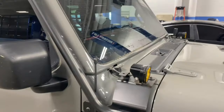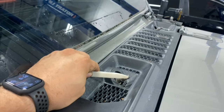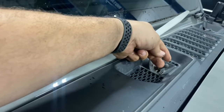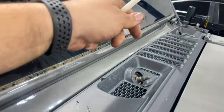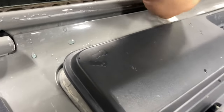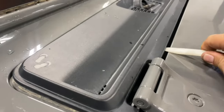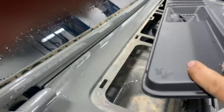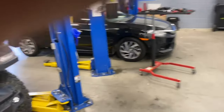It's only on one side, it appears. So I have 15 millimeter bolts on each one of these wiper arms — just take that 15 millimeter nut off. Then what I do is I rock it back and forth. You don't need a puller; you can just take them and rock them back and forth and they'll kind of pop loose and just pull them off. Then I got a plastic trim tool — what you're going to do is kind of work your way around it. It's just held in by clips, no bolts or anything. Just work your way around this. It's plastic, so it ain't going to hurt nothing. Once you undo all the clips, you can just pull this off, and that will allow you to access the hoses, which you need to tee into.